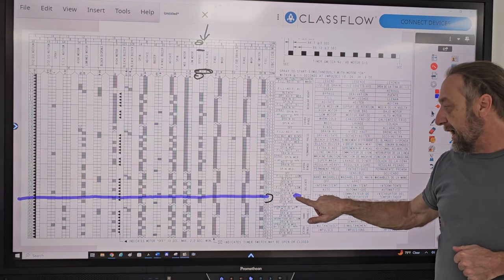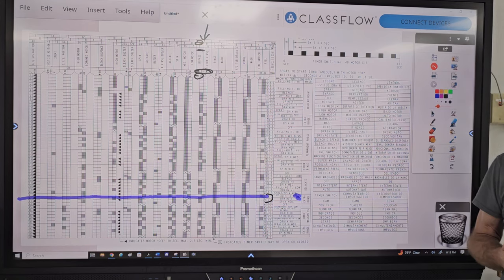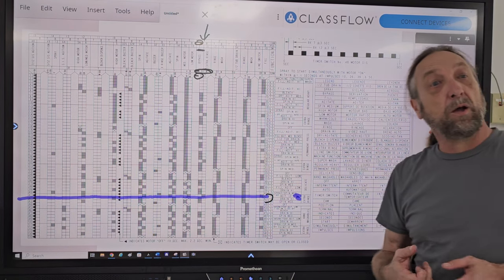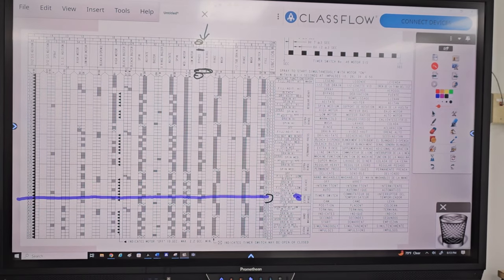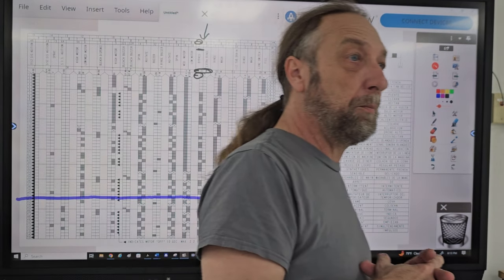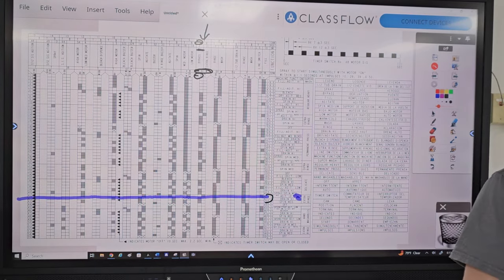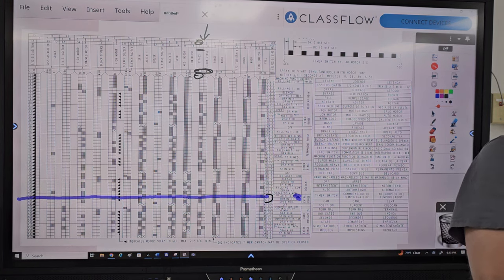Why do we go to drain high then? Why can't we just keep it on low speed and go to drain? It doesn't affect the clothes, and you can do it quickly. It doesn't affect the clothes because it's just draining water. Yeah, but on a low speed, the pump is directly mounted to the main motor on this model. Some pumps on some washing machines, especially front loaders, have their own motor, okay?